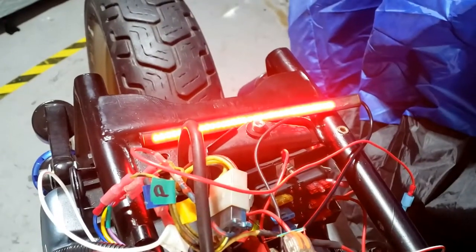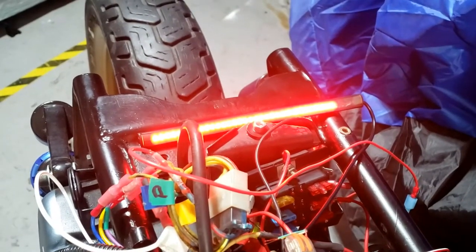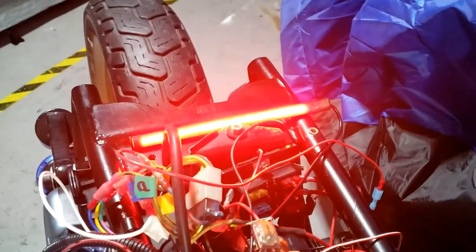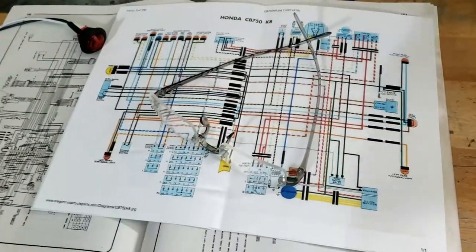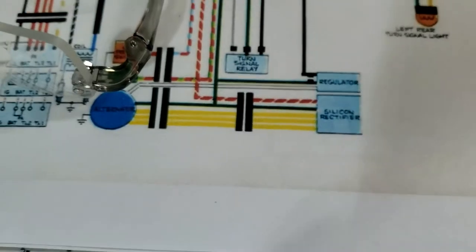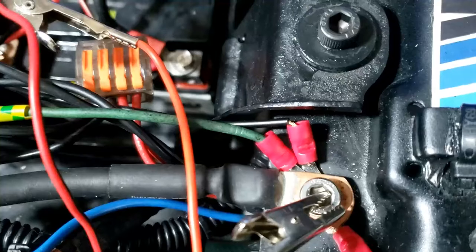And with the real brake light strip, we have running lights, we have brake lights. Running lights. Brake lights. Kill. And I've been persevering. I've worked out that Reg the rectifier has a green, which corresponds to that green and that's an earth or a ground. Another mystery solved.